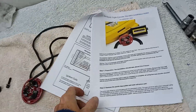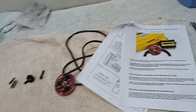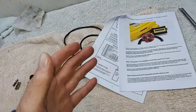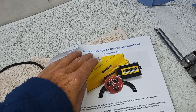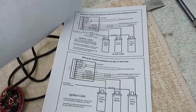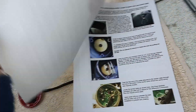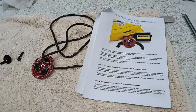One thing I forgot to mention: I've downloaded the fitting instructions from the internet. All the manufacturers of electronic ignition now have their instructions on their websites, so you can download the correct fitting instructions for whatever system you've got. I've downloaded the ones for the Tri-Spark triple with the box fitted — it includes wiring diagrams and is very clear. There is one old anomaly I'll mention when we go through it, but it's very important to have the instructions.